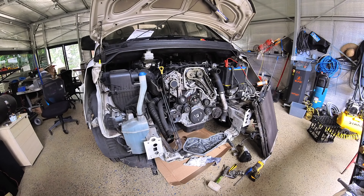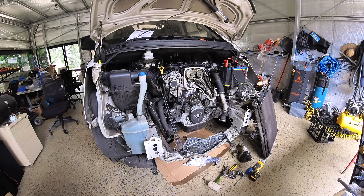Okay, so I stripped the oil down and from what I can see the timing chain tensioner is doing exactly what it needs to do. The timing chain is doing exactly what it needs to do. One thing I did notice was the squirt of oil did take a little bit — maybe five seconds — until it started squirting properly. So there's always going to be more than one possible cause to this problem. The first one I looked at was the timing chain because in another video it looked like it just wasn't clicked into place.